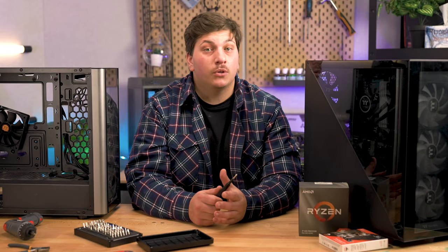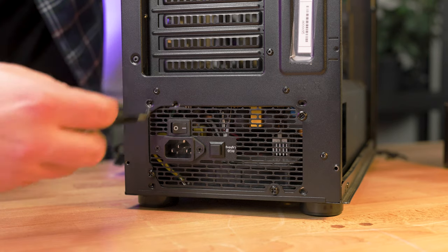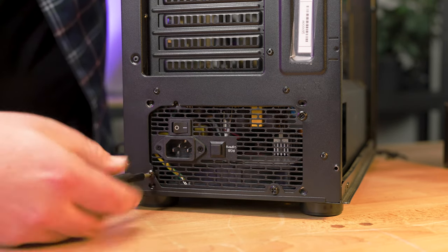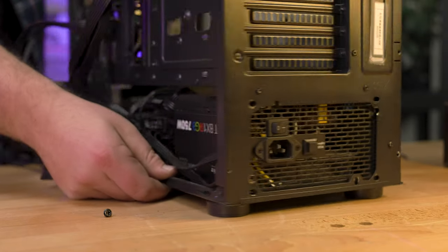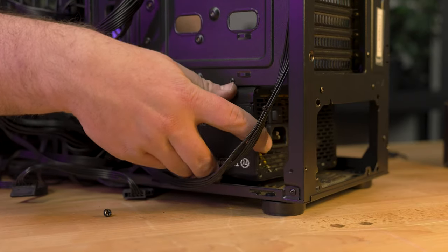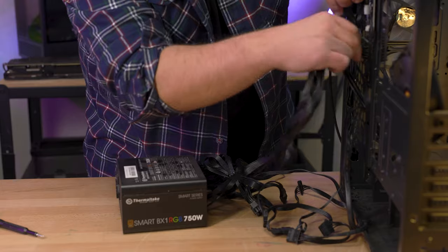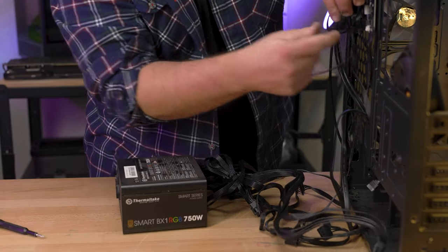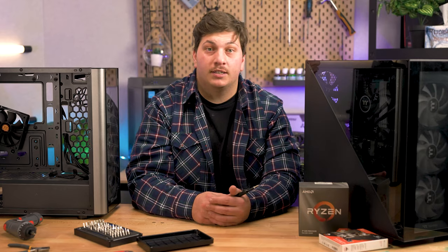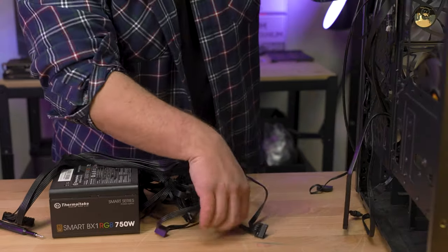The last thing to do is strip out the PSU. Remove the four screws holding it into the case from the outside, then slide the PSU out from its bay. The aim is to leave all cables plugged in so you don't have to replug them into the PSU. With this model it's non-modular so the cables can't be detached anyway. While you're here, detach any other accessories like fan controllers and remove your SATA cables as well.